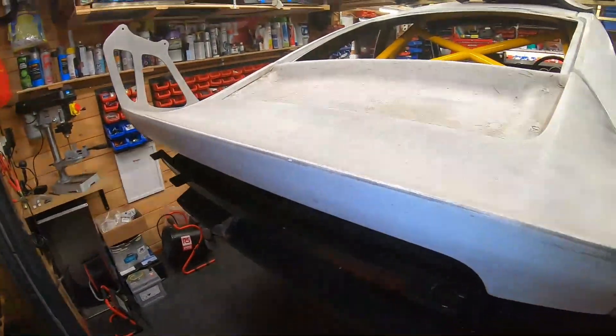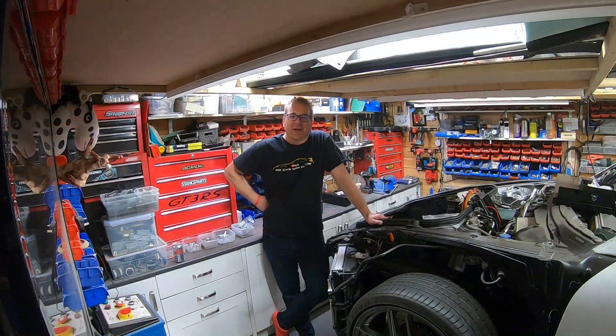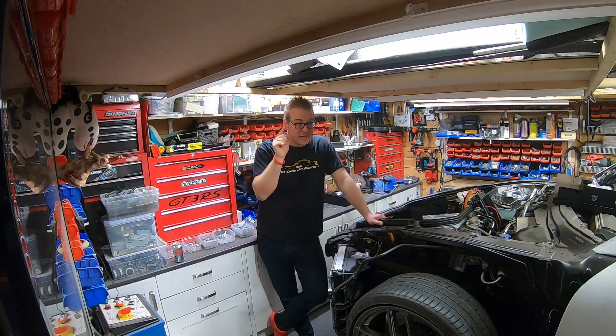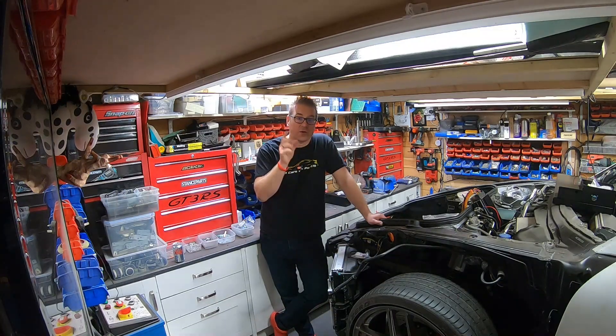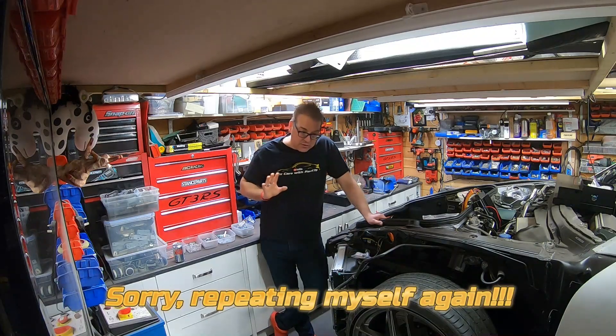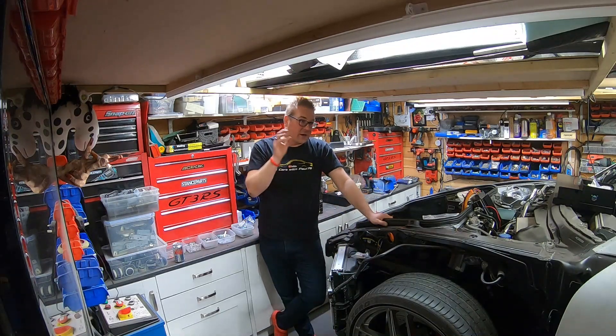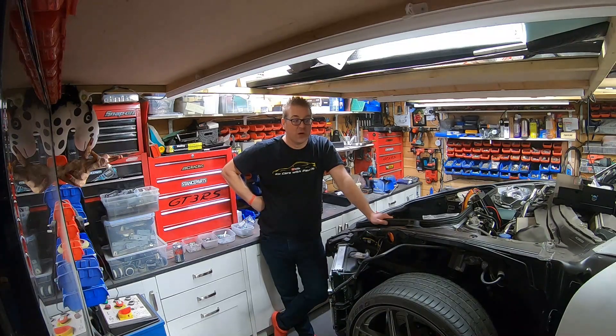A big milestone reached — installing the LDU subframe and battery boxes hopefully for the final time on the build. I'm sure there'll be times I have to take it out, but fingers crossed. I've tested everything coolant-wise on the battery boxes so hopefully we can crack on with the next stage. What I need to do next is put new handbrake pads and discs on, fit the wheels, get the car on the ground so I can move it back, then use the crane to lower the batteries into the front box. At that point I'll have enough power to make the T2C control unit work, so we might be able to spin the motor for the first time. Fingers crossed — hopefully it's not too long until next time. See you later, gang!